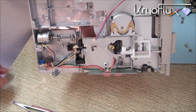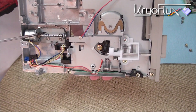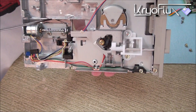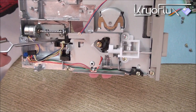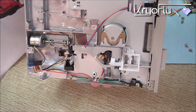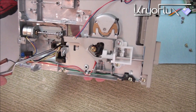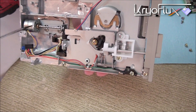Let's talk a bit more about the lead screw and stepper motor. The stepper motor steps through discrete positions in a continuous manner and relies on the drive hitting track zero using the track zero sensor to orient itself whenever you turn it back on. It's very important that during these modifications you don't move the track zero sensor or change the position of the stepper motor forward, back, left, or right.